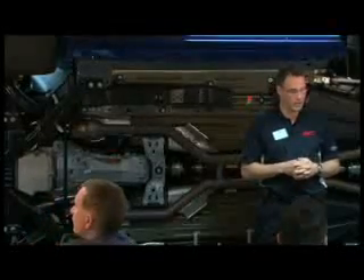The transmission — many, many parts have been upgraded. The helix angle on the gears has been changed to give us more torque capacity. We've upgraded a number of the bearings internally. In fact, in some positions we've gone from a separate taper bearing and needle bearing to a straight needle and a thrust bearing. We've upgraded the output shaft and the counter shaft. The output shaft spline went from 28 tooth to 40 tooth. We also have a new tail shaft housing because of the unique application, and also because of the one-piece drive shaft, which I'll talk about in a little bit.